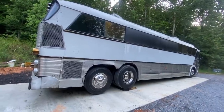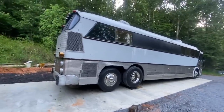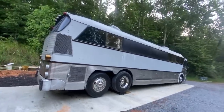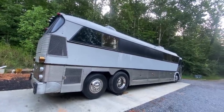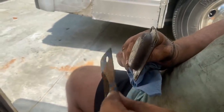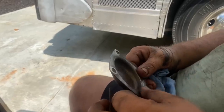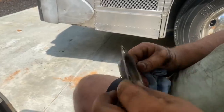They definitely use it a lot — they've been traveling to a lot of shows playing their music, the Farmhands Quartet. It's really neat to watch guys that are out actually playing music and keeping people happy. Anyway, it's a great bus and we'll get into the transmission leaks here. This little cover — we actually replaced the gasket last time, but it needed a thicker gasket. So I've got a cork one to go on there that I made. It's got a little bow to it, it's not completely flat, and I tried to clean it up and tap it back. Hopefully that'll stop his transmission leak.